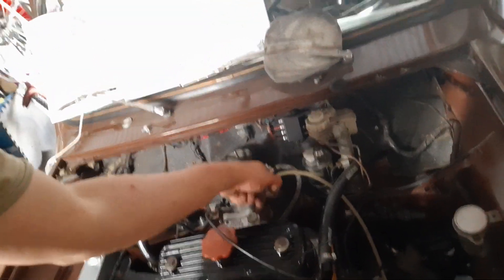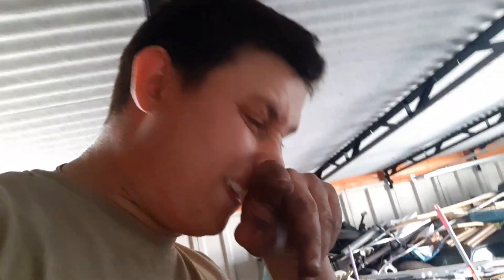So I stripped it down. The guys made a few suggestions, I checked this, I replaced this, and it's now back in the car. All six bolts are back on — the dashpot, three there and three actually on the carburetor dashpot. I checked it all over, I made sure I was getting fuel to the carburetor, I was getting spark. And yeah, I am absolutely ecstatic.